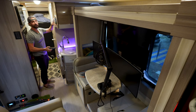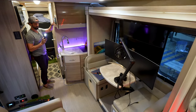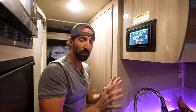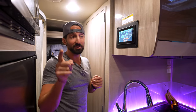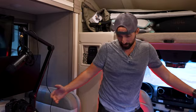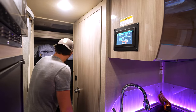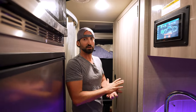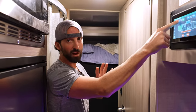The first thing I'm going to do is press the extension button on the dinette slide. You want to hold the button until it is all the way completely done — I'm still holding the button — you want to hold it until the slides are all the way out. Otherwise you can cause an imbalance in your slides and they'll get off track. Your slide won't close when you need it to — it's a nightmare, do not do that. Look how much this opened up the space. There's so much room now. One huge thing to note: always make sure none of your drawers flew open and nothing fell off the counters behind the slides before you extend them — these motors are powerful and will break whatever gets trapped there. Do your checks, then hold the button all the way through for the rear slide too.